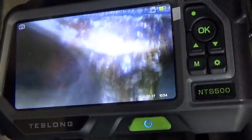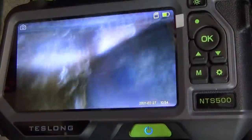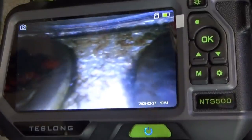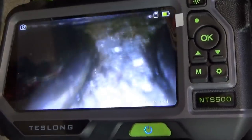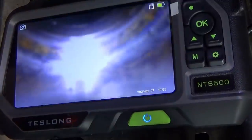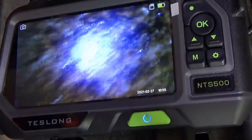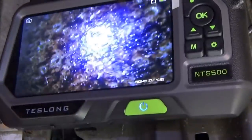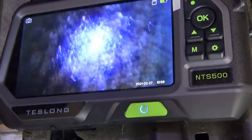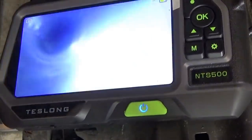What I want to do is install a pressure transducer and see what the running compression waveform looks like, then compare it to another cylinder. The piston itself also has little pits on it, and it's oily and wet because it wasn't firing.